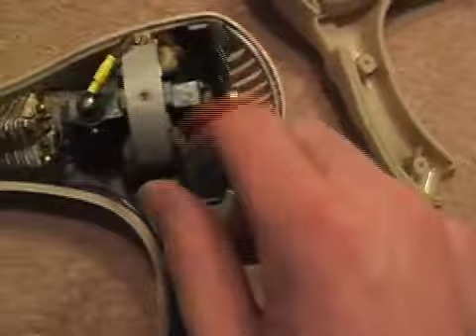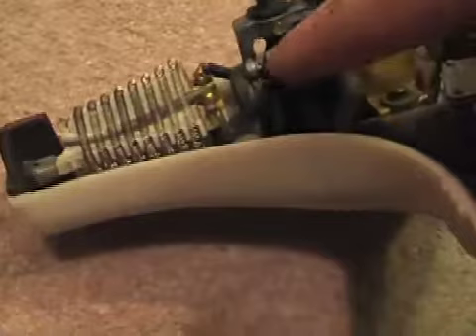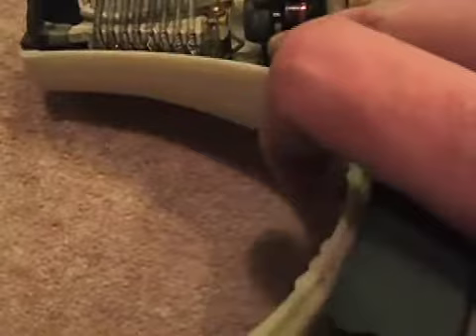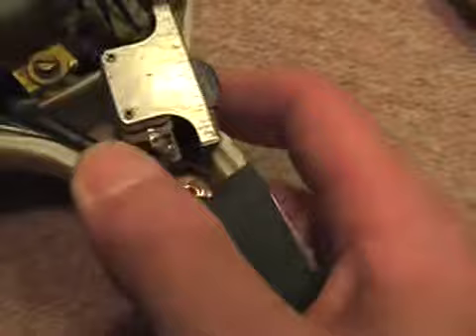First of all it's quite dirty, lots of bits of hair inside, not much of an air filter there. Carbon brushes — they make quite a smell. Well, I did plug it in earlier and it did run without going up in smoke, but it smells like the old fashioned model train motors. There's a tiny element there, and switches made of laminates of what appears to be a bakelite-type material, and in the handle there's this capacitor.